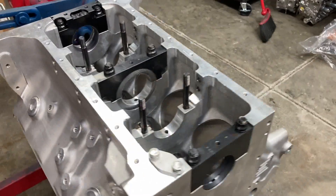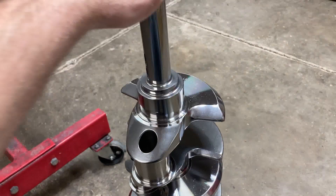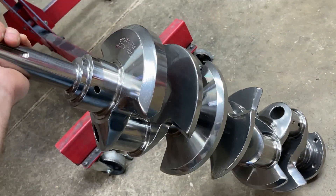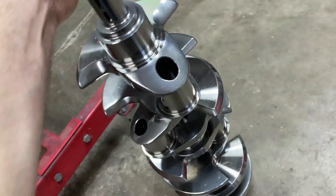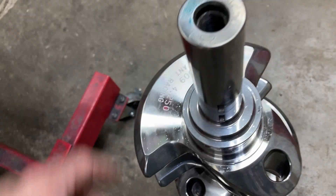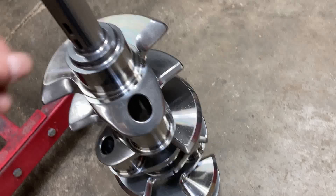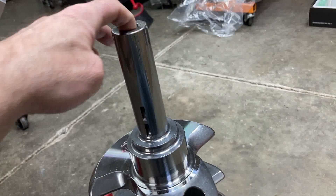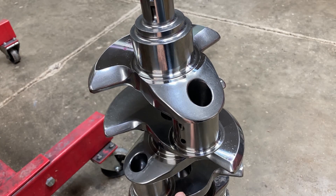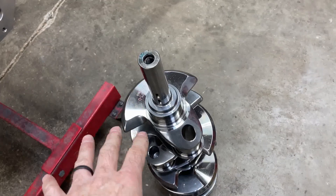With all that said, I'm going to start looking at some bearing clearance checks. This video probably won't do any justice to this crank — you can see how shiny it is, a mirror finish with the rim polishing. If I put my hand up here you can see it in the counterweight. It has lightened and hollowed rod journals, and it's been gun drilled — drilled all the way through on the centerline to lighten it. This is a four-and-a-quarter stroke.